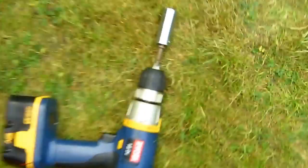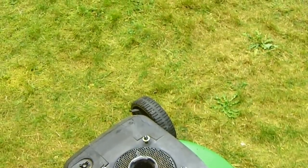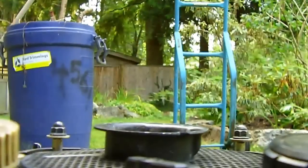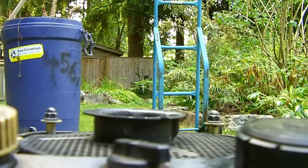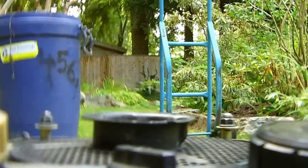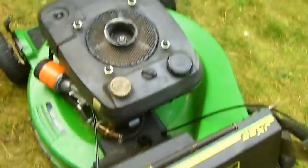Grab my drill, my drill starter. What's that on top here — when I attach the socket adapter and the socket, they range at Home Depot about 5 bucks, they're great to use in mowers. If you ever got a mower that sits through storage, you know what it's like when it wants to start but it won't start after it sits. Remove the recoil as directed, take your socket adapter, socket, and your cord or cordless drill as shown there.